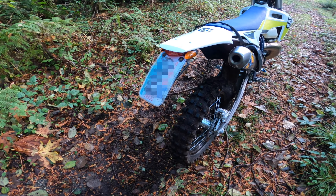On the 2021 KTM/Husky, they have not fixed the power valve leak — I'm sure you've heard about this one. Mine is leaking just a tiny bit; you can kind of see that little dirty dribble coming from the power valve cover. Mine's not too bad — I haven't washed this thing in at least a couple hours of ride time and it's not much. The 2019 gaskets will fix it. I'm probably not going to bother unless it gets worse, but it's frustrating that KTM has not addressed the issue yet.